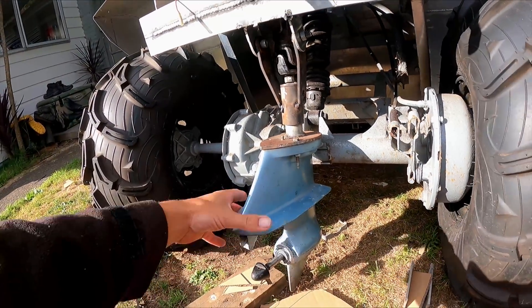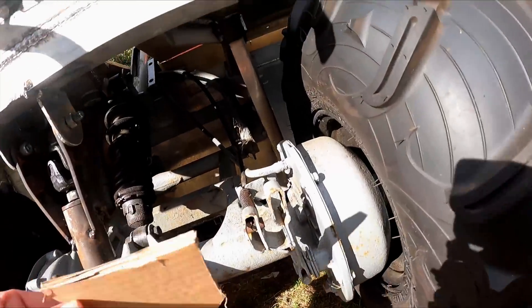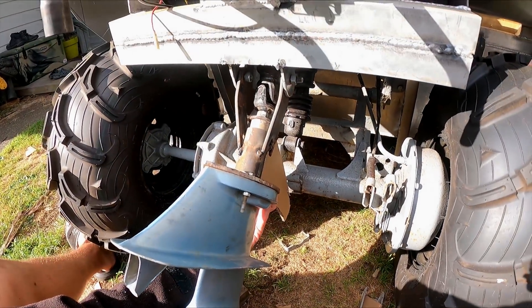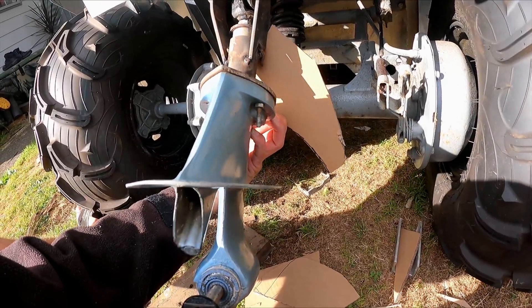The way that this is going to raise and lower is I've cut out a few different patterns. This is the one that seems to work best. So that's going to be like a fin that pushes on the diff — the ATV diff comes up, it'll let this slide back into position. I'll go up and down a few more times and then I'll cut this piece out of steel.